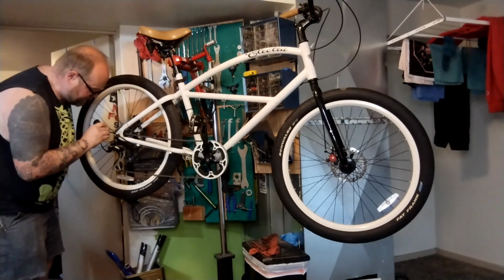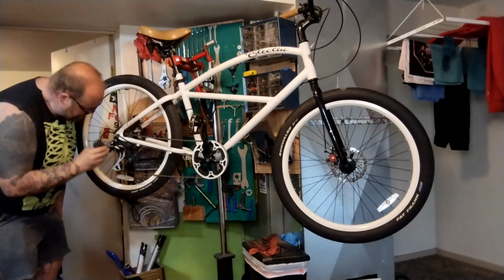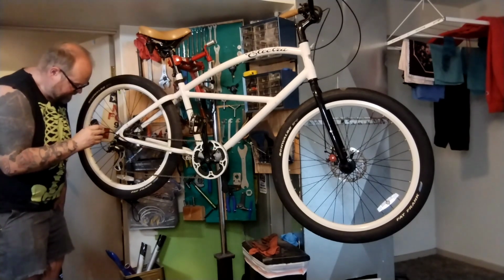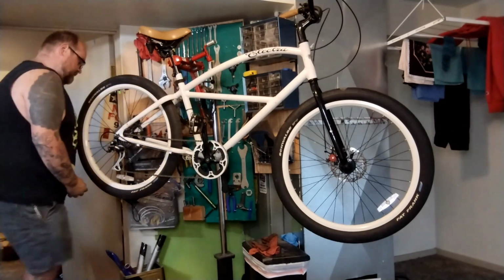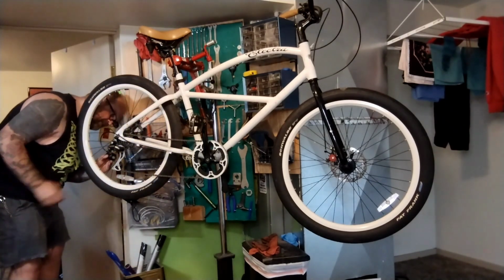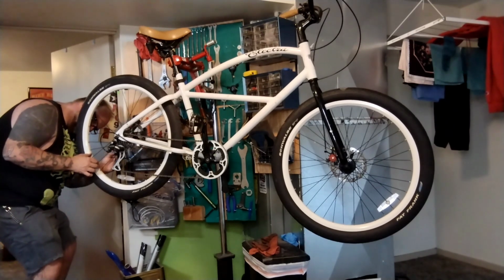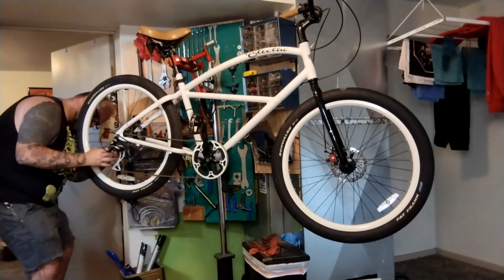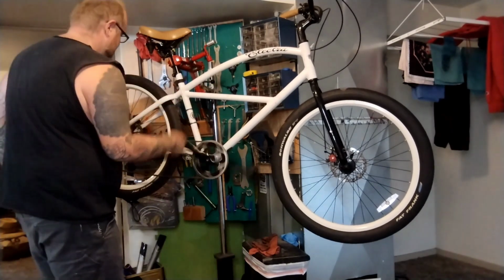I drop in just a little drop under these pulleys. I'll often drop a little drop on any pivots on the derailleur to make things move smoothly. Coming and doing the other side, if you can get under that pulley. You don't want it all over the chain, all over the outside, sticking dust and road grime and making a mess, but you can get a little where it can work its way under. That is great.